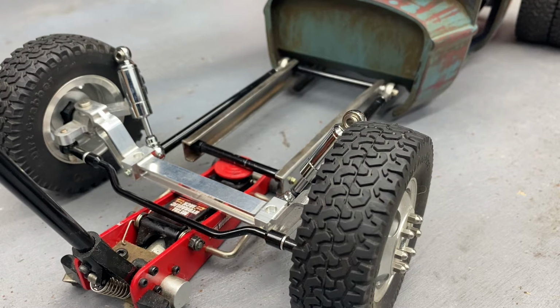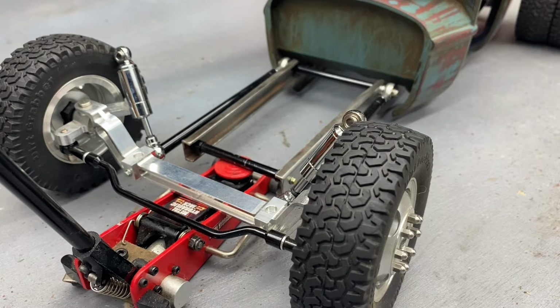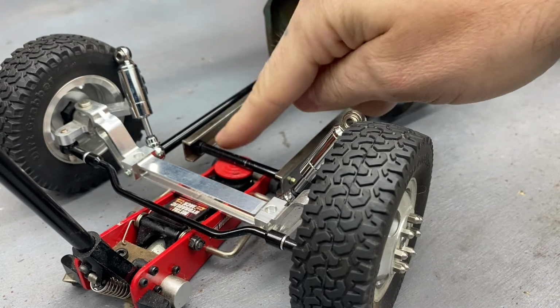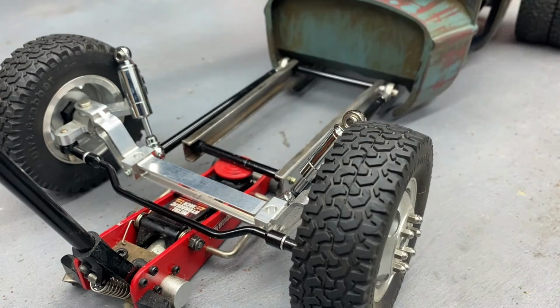I'm thinking with only two holes, if you just bolt something to those two holes, it's gonna flop front to back. So that won't work, obviously. So what we're gonna have to do is make like a sleeve insert. Think of the receiver hitch on your truck. It slides into the square, can't move left or right. So if we make a sheet metal piece and slide it in here and bolt it through that hole, we can make it come back as far as we need to be rigid enough to go across the front. And then we can bolt to that. We can mount the grill.